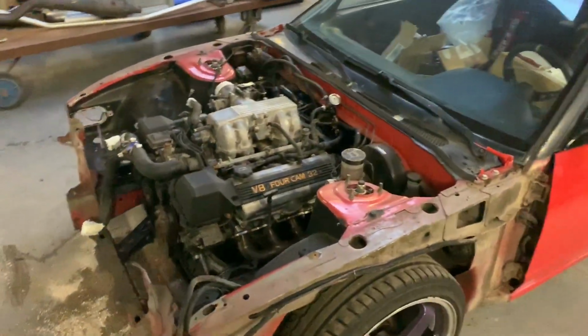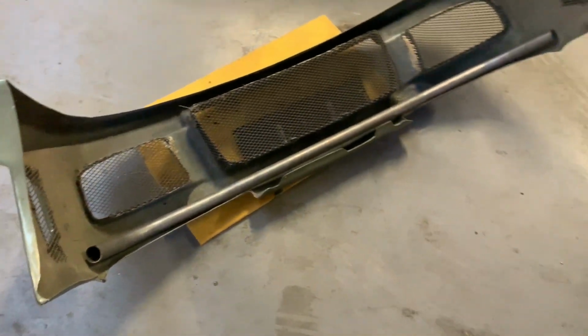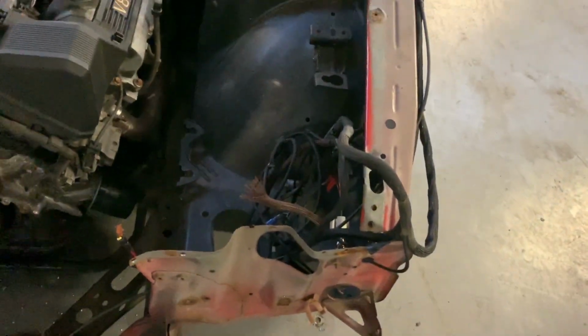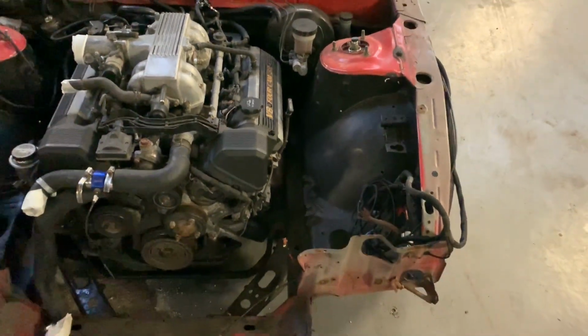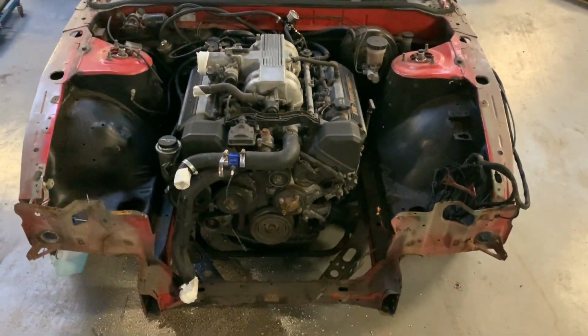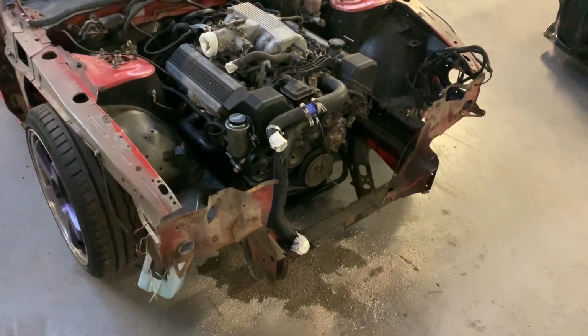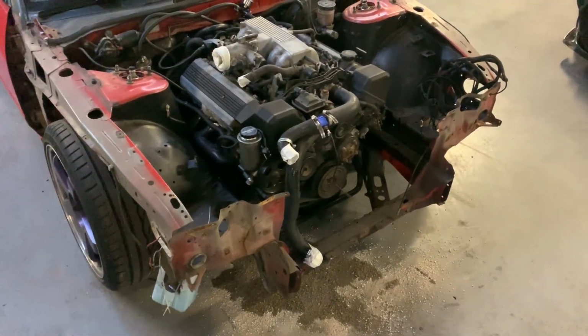And now we have to fit some of the parts, like one of them is this S15 bumper. As you can see, we put the bash bar inside there, and there's a couple other parts that we have. Like the S15 headlights, super nice. And we need to cut out this section over here to make that fit, obviously. It's actually got some Chargespeed fenders from Japan in order to make this an S13.5 as it's called. So the next step is to cut out everything that obstructs the S15 headlights, and we're gonna make some brackets to tilt the radiator forward a little bit.